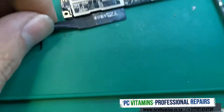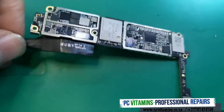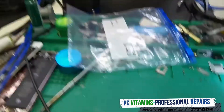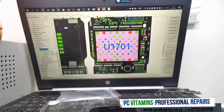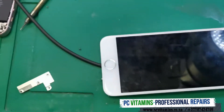So we'll remove the various capacitors around the NAND area that I think are getting hot. The short was on the PPP1V8 line. Let's test if it boots.